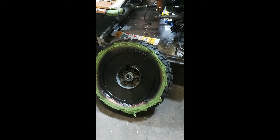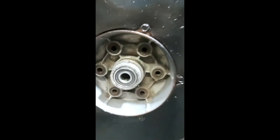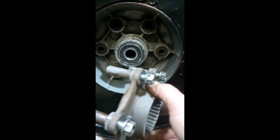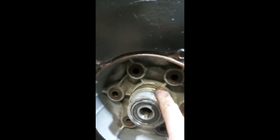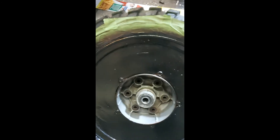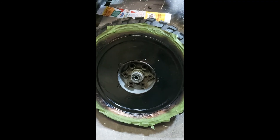The back wheel is sorted — there's a new bearing in there. The whole hub area was absolutely filthy with grit and crud. These five holes correspond to the hub mechanism, which was also in bad shape and has now been properly cleaned up. The pins will be greased as they slide in and out of the holes, and the gearing part in the middle will also be properly greased. The o-ring at the back has been sorted too. The outside of the wheel will be rubbed down — there's grit on it but that fits with what I want. There's copper paint underneath that'll be brought back up for a nice finished look.